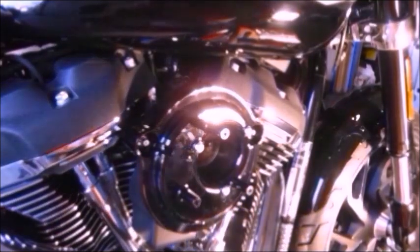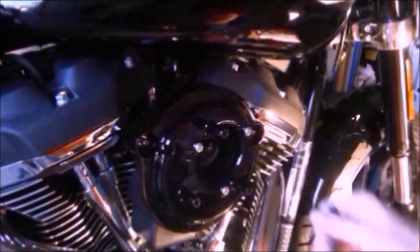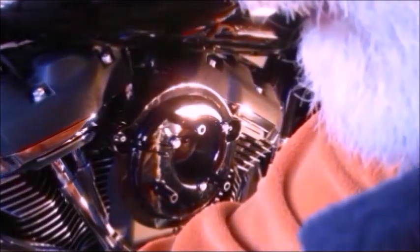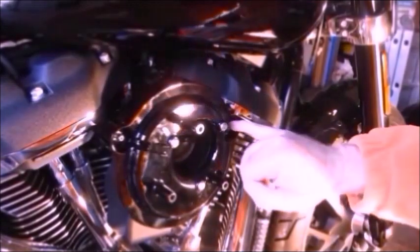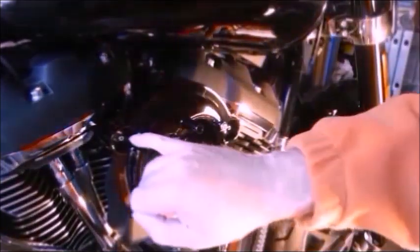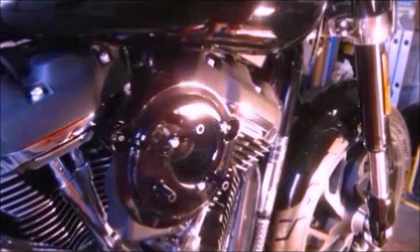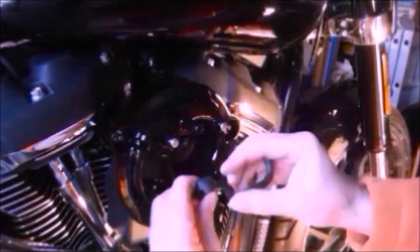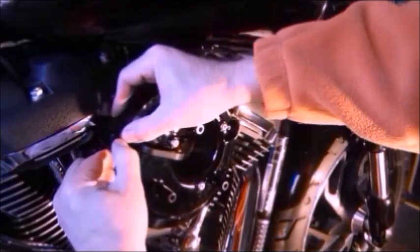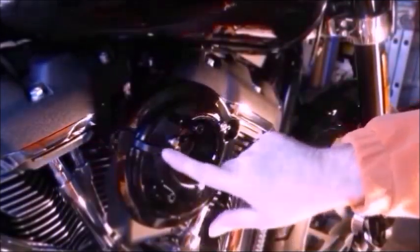Assemble your breather tubes. And to make it easier to pop them on there, what they say is to put a slight dab of oil on the end of the breather pipe. So you take your oil can, I find it easy to put a dab on your finger because it's easier to then get in that hole. Just put a slight dab of oil around that, which should then enable, because there's quite thick rubber on that, it should enable that to pop on there a bit easier. And that then, there's a groove there to slot that in.